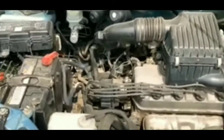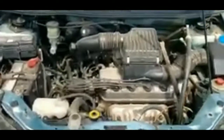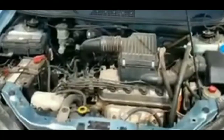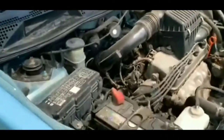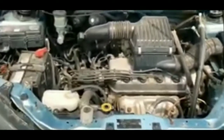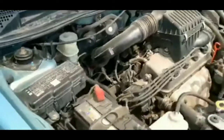It cranked each and every time I tried to turn the car on — it would crank but it wouldn't start. Originally I thought it might have been the battery. I changed the battery about six months ago, got a value brand from Walmart. I was hoping it was the battery because that's one of the cheaper fixes, but I was on the fence because the crank was very strong. Normally a weak or dead battery gives you a slow crank.